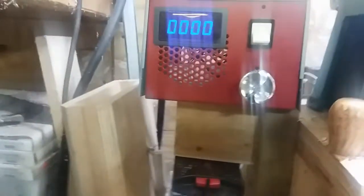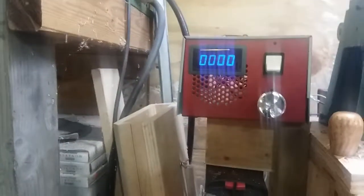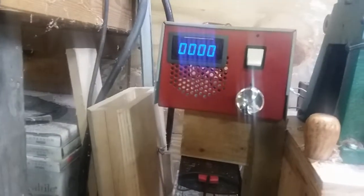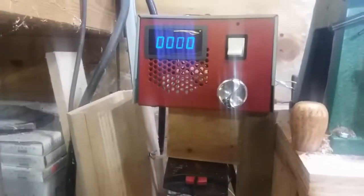The way I have it set up is I have a power bar over here on the side of the bench. I plug in the tachometer power, the motor power, and my shop vac for dust collection. When I turn the power bar on, my light comes on and the whole box would power up — but I was having a tendency to leave it on all day, which with the wood chips building up in there is pretty much why it cooked that board.